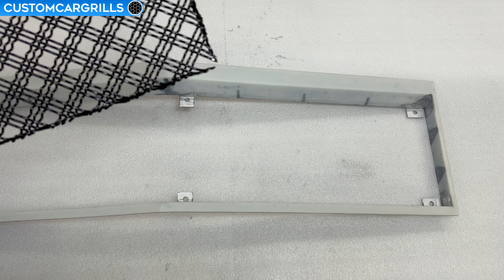In this close-up, you can see me using the spreader to flatten out the application so that we're going to be left with a nice consistent height. When it's all painted up, we won't see much of any of this when there's a shadow on it, but when the sun hits it, we also want to have a nice consistent look all the way through. I'll let this cure up one more time — we now have the grill that's almost finished. All I need to do is give it a paint job, and we're going to be blacking out the whole thing. I'll make one more pass over it just to make sure everything's nice and smooth, and then take it to the paint shop.